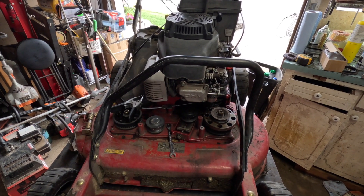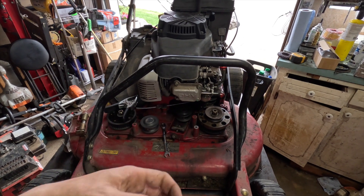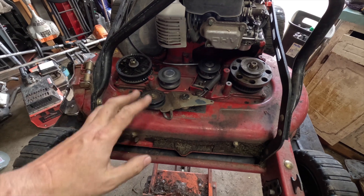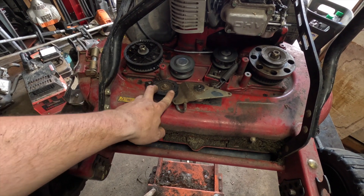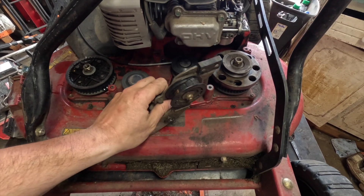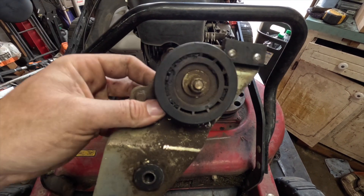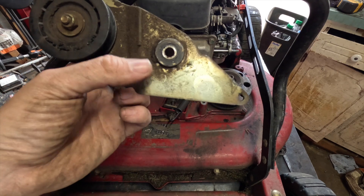It is going to require quite a bit of work. I'm going to show you what I'm replacing so you can know the ramifications - not necessarily how to replace it, but what can go wrong if you over-tighten it. First thing that's going to happen: if you over-tighten it, this idler pulley is going to bear pretty much the full force of the tension and it's eventually going to start to wear out, get hot, and seize. Pulleys are not supposed to look like that, so this one definitely needs to be replaced.